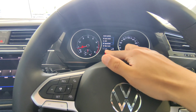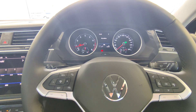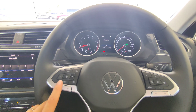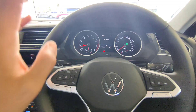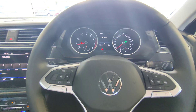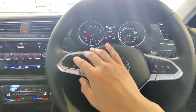You can adjust the speed limit up or down using the plus, minus, reset, or set buttons — a green light confirms it's active, and gray means it's not. To switch back to adaptive cruise control, tap the side button and select ACC. For lane assist: when turned on and driving over 60km/h, the vehicle detects your lane markings and helps keep you centered if you drift. For side assist: this is your blind spot detection — lights on the mirrors will illuminate when a vehicle is detected alongside or behind you. You can toggle any of these functions on or off.